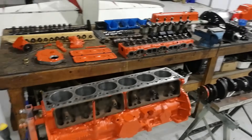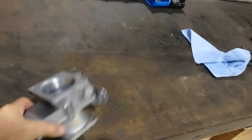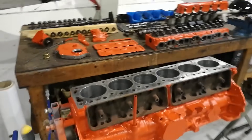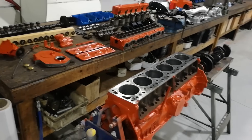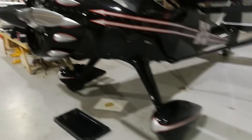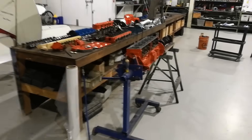What we've got here is an engine I purchased secondhand for a couple of hundred bucks. The idea was we were going to use this engine to test our throttle bodies. Here at Rotec we make these throttle body systems - this is an old secondhand one, but you get the idea. We need an engine to set the idle up and make sure they fundamentally work properly. We check them on the bench, but unless we physically run them on an engine we don't actually know that they're spot on. Most of the time when we send TBIs out they're good - we check for flow rates on the bench. We can also run them on our radial engines, which we manufacture here as well, to check for customers, but that's not always available.